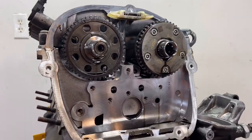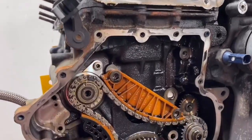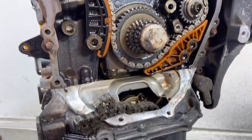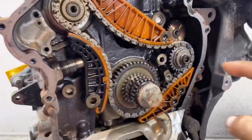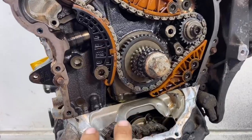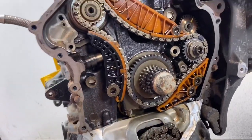Here's where we're starting with this video. I've got other videos that show disassembly. We're not doing the balance shaft timing chain right now — we're just doing the camshaft timing chain and we're leaving the oil pump chain alone right there.